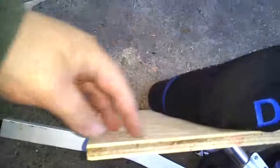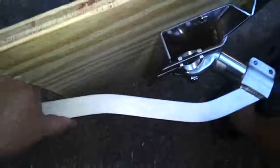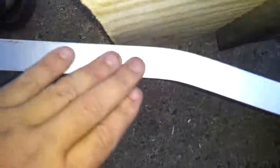I got the reinforcement on — four screws going into the seat plus the four screws going through the seat into the bracket, so the seat is reattached. I'll add extra cushioning here so my butt doesn't come through this opening. I also brought it as far back as I could without interfering with the backrest. I'm going to put a piece of metal or wood in here because this moves and I want to stop that — a support wrap sandwiched in here, bolted to this plywood, giving me a third point. That'll keep the seat from twisting on me.